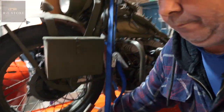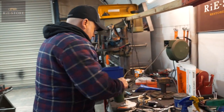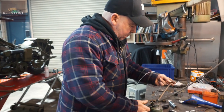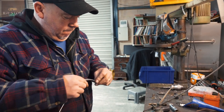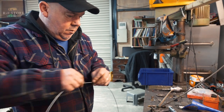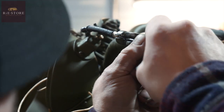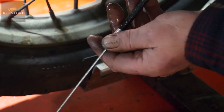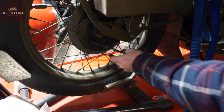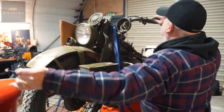Now we can feed our inner cable through — give it a bit of oil. All I do is squirt some oil in my hand and just run it down the cable. You can buy cable oilers but just a layer — just give it a little bit of oil. That's all it needs. There you go, that's nice and free.